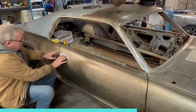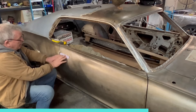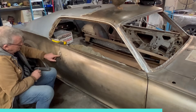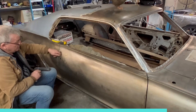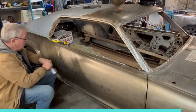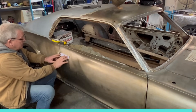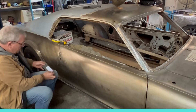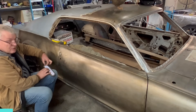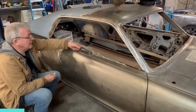Don't get caught in that trap — realistically this door handle is going to have to go about there. We can keep that top line level, but all this here is going to have to be filled in. There's also a little stamped piece of the panel that's a Cougar thing, so I'm going to cut that out as well while I'm flattening and stretching the panel. When getting your back measurement it's this plus that, which is about three quarters of an inch.